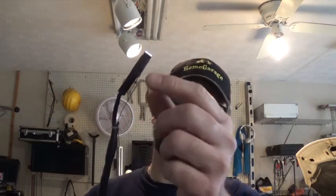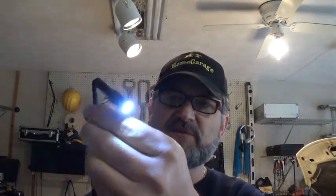So this is the system I'm using — very easy. Just a little eyelet, secure the string to the head of the camera and just pull it, and you can bend the scope. As I'm inspecting the valves, you can increase and decrease the angle of your camera head as you're turning around. Now you can see my head is kind of pointed to the side a little bit — you just have to move this. Again, this is still experimental. I'm going to try to see if I can get it better. But I can bend it so much that I can actually see my spark plug hole. No other scope can do that.